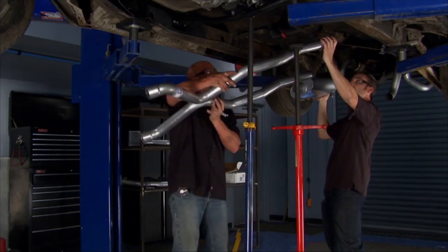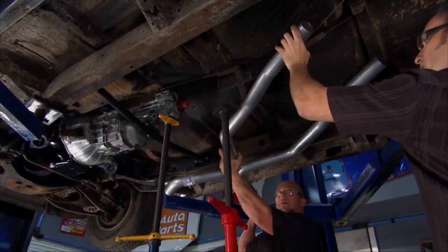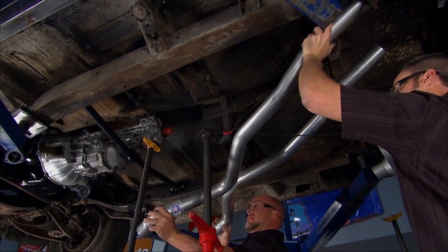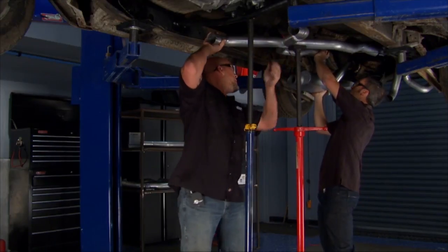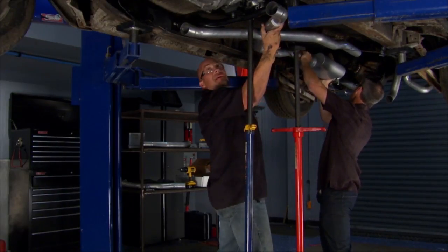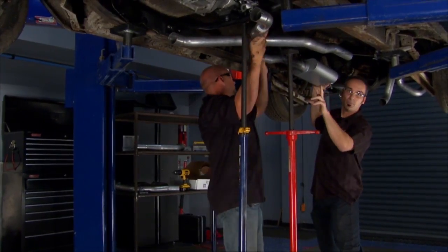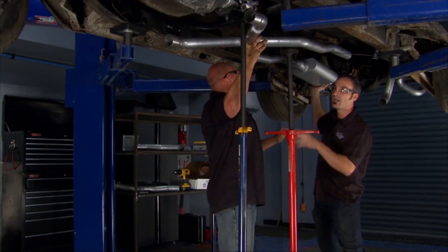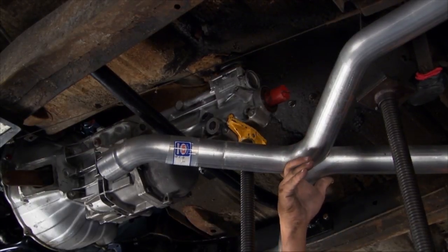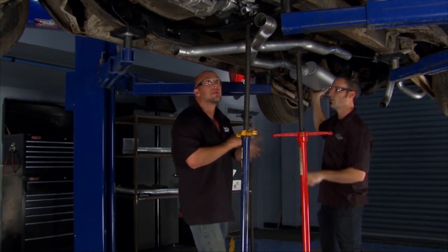Let's feed this guy up and over. We'll try fitting some stuff in here. As you can tell already, this cross member is going to cause us a problem. It was mounted pretty decent, but no matter what we put on here for exhaust, that thing is just right in the way. So let's get ourselves a little bit mocked up here. I've got the jack already into the trans because I can see we're going to have issues. Let's rework this guy up here and then we'll make our way forward.